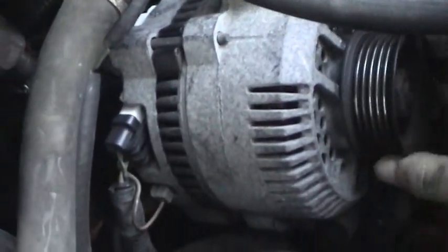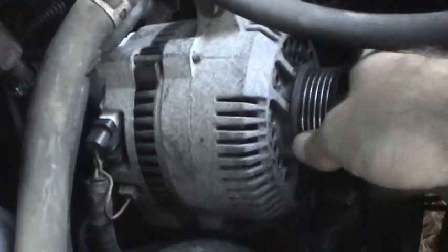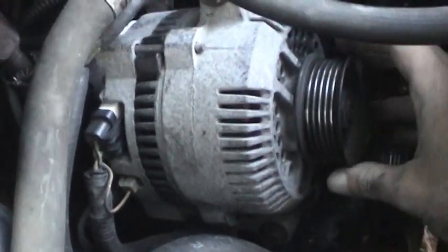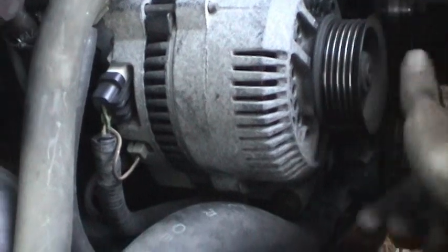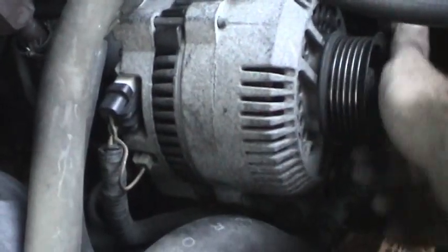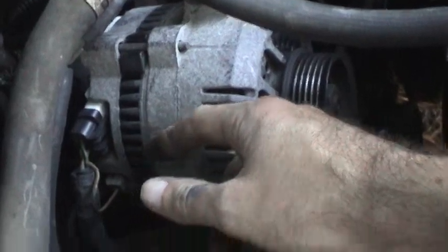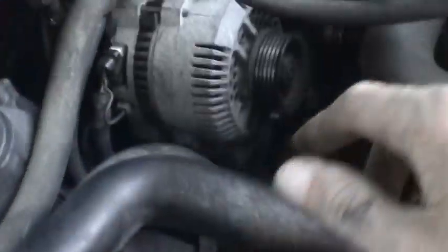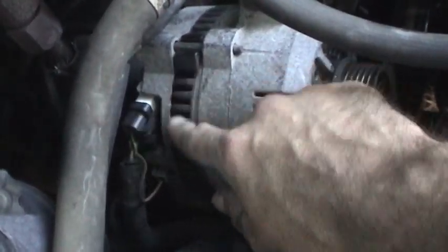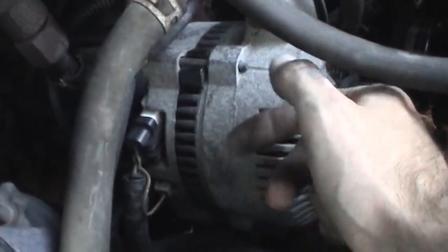So I know that when I put the belt back on and start it up, I'm going to have a perfectly functioning charging system. That's a quick test you can do if you think you've got charging problems. If your battery light comes on, just take your belt off and see how hard that alternator is to turn. If it freewheels like it was before, you've either got worn brushes or you've got a bad voltage regulator. If it's hard to turn but still not putting out any voltage — 14.2 volts across the battery — then you've got a more serious problem: probably burned out diodes inside the rectifier assembly, or possibly an opening or a short in the stator, though that's usually pretty rare.